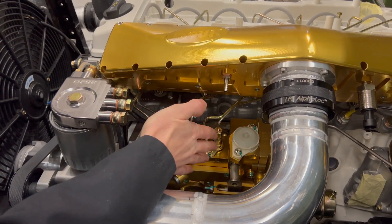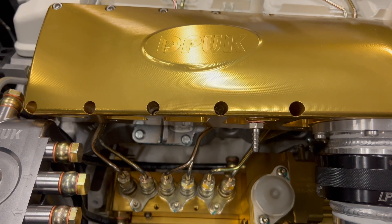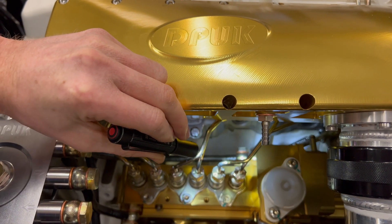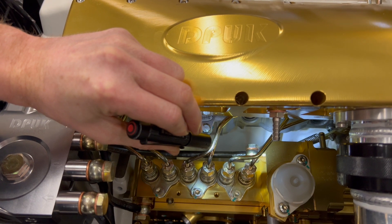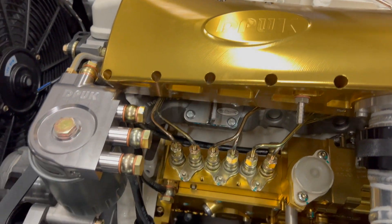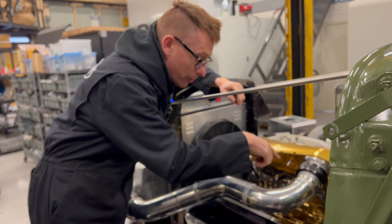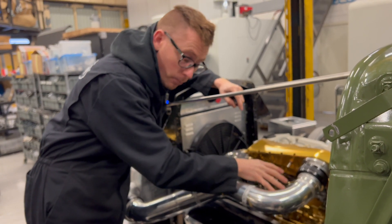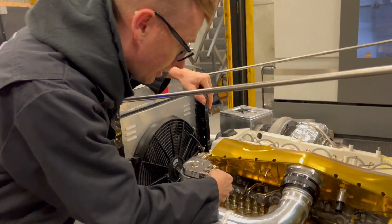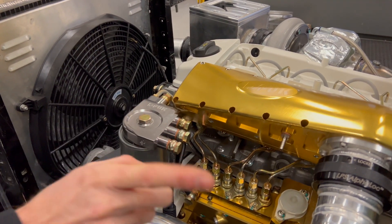You can imagine the fuel has been pushed into here, and then at the back — I'll get my torch out — there you go. You see at the back there: this banjo bolt at the back is the restrictive one. That banjo bolt basically holds the pressure inside the fuel pump. So this one is feeding it into the pump, the pressure is being held at that point in your pump, because it's really important that you have pressure in the pump. Then that next pre-made line from there goes back up to the housing, to the port marked 'R' for return — return from the pump.